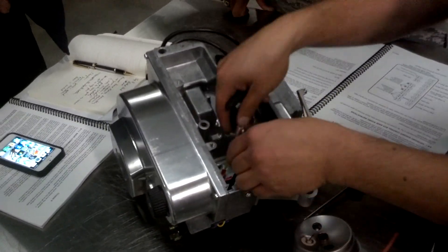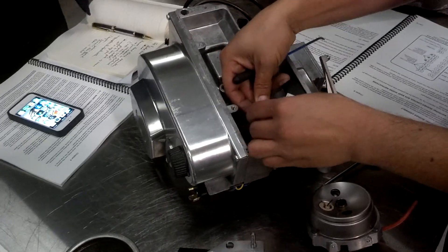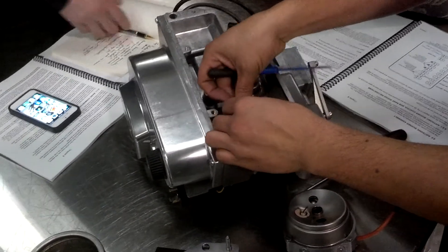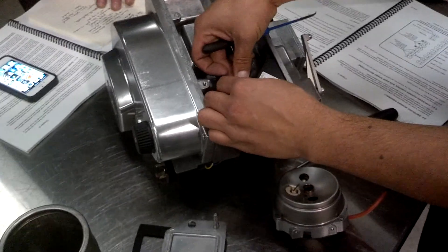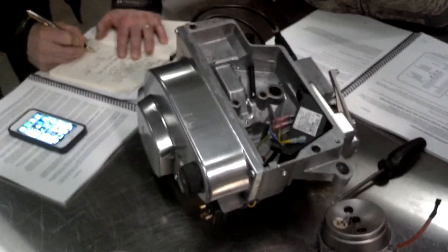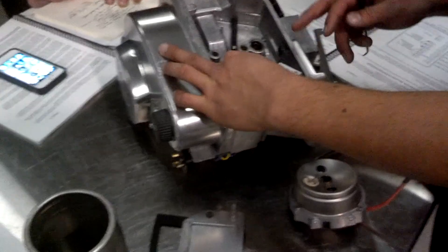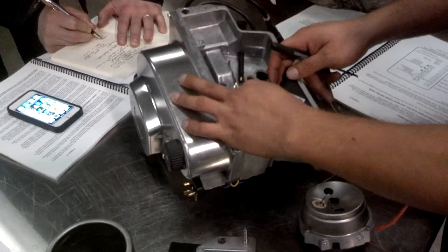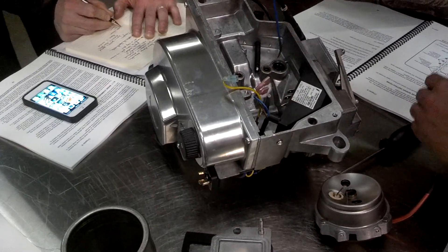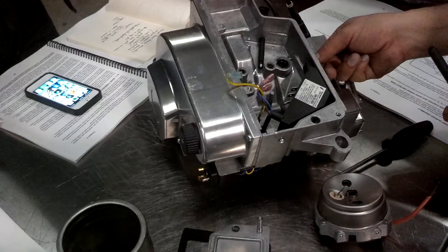So you want to make sure that when you put the transformer back in and have everything plugged in, you bend these tabs or bend the wires away from the actual seat. That's why I have them bent that way — bent away from the atomizing chamber. Because that little thing could cause leakage inside of this lower fan house, and then it might leak out the nearest exit, which could be this screw hole right here.